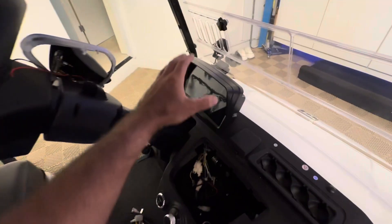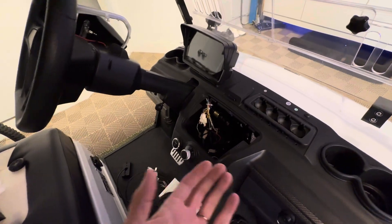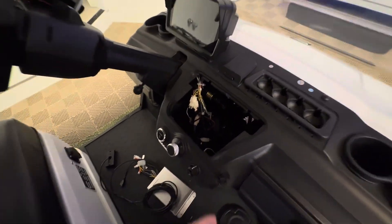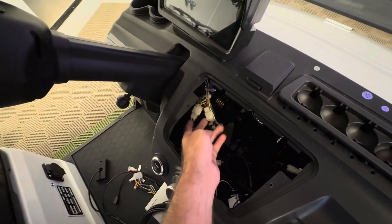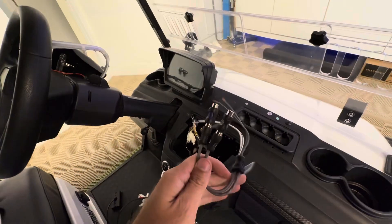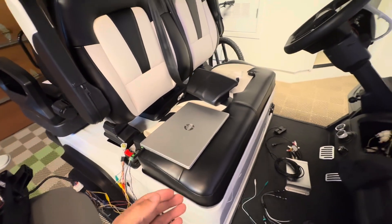If you really just wanted to tap into your stock head unit's line in and line out, that's not a big project. Generally, that might be one of the solutions we build in the video — how to build a plug-and-play connector for these audio lines. One is power, one contains your audio. You can have a nice little RCA out line on it and wire it into an amplifier, which you might want to locate underneath your seat.